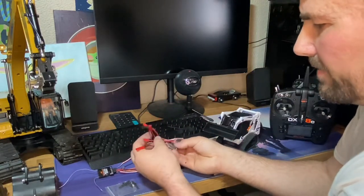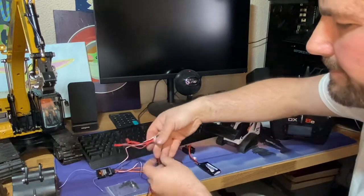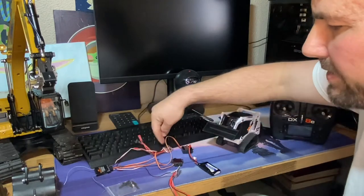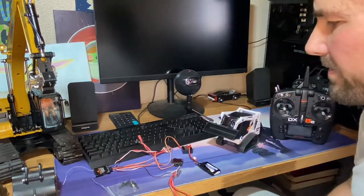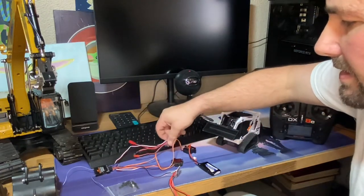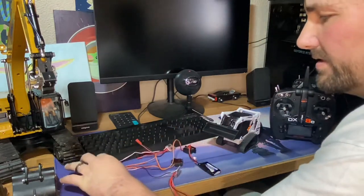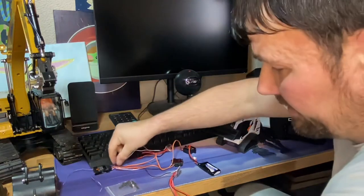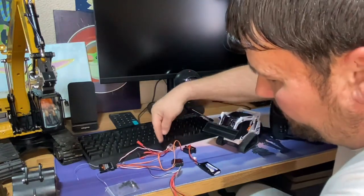I can link these however I need power to get power to them. It's got brake and no brake. I'll probably remove the power supply going to it and just use an accessory wire — so that may power it, though I think I'll have to give it its own power. I do need the accessory wire for sure, so I won't be giving power to the receiver from both of them so I won't burn it out. It'll just be an accessory wire — I'll roll up the rest of it neatly and just keep it circle-wrapped right here.